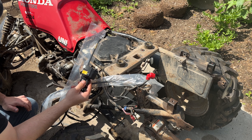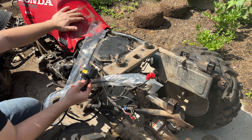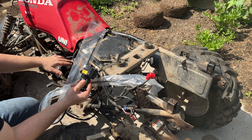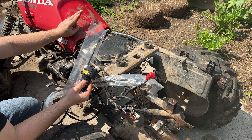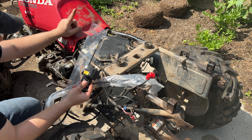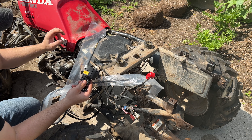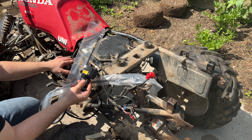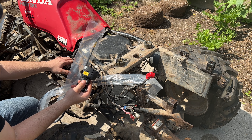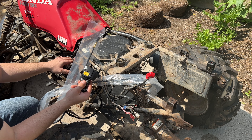I need to check the wiring and see if we can narrow down why it won't start, as far as the starter goes. There are two things that can affect the electric starter not working, and one thing that can affect both the starter and the kick starter — that's the stator. So I want to check if the starter works today and determine whether I have a bad stator and whether I'm getting spark. I've got a few things to check.